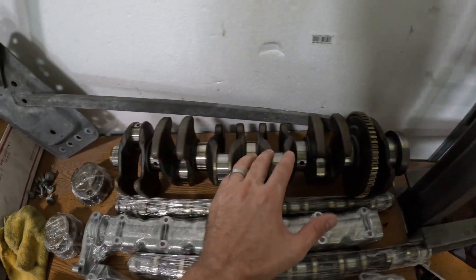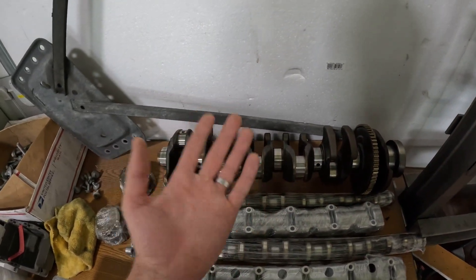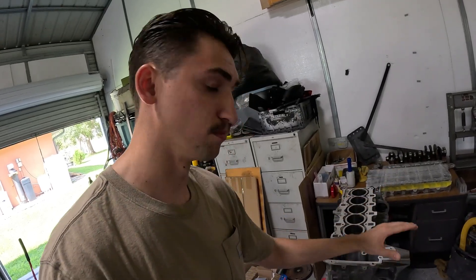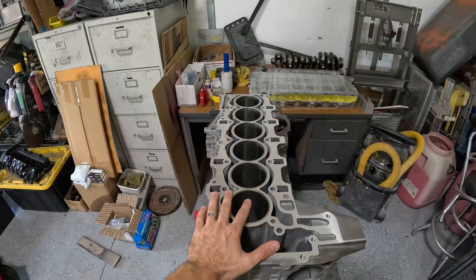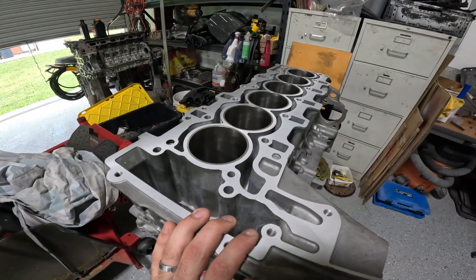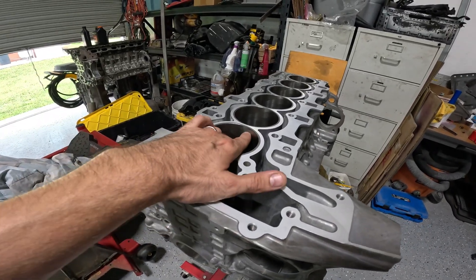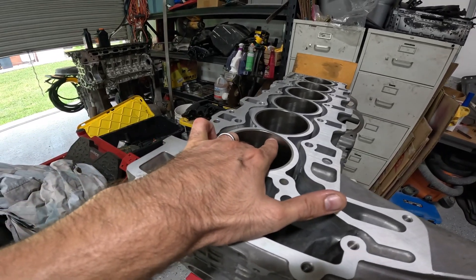The crank is in perfect condition so we can still use it. It is an 8 bolt but I will be using an upgraded flywheel for a DCT transmission. I already fully stripped out the motor and the head and took it to a machine shop — they checked everything and it's all in spec. I got both the block and head resurfaced, and I also got the cylinders honed. They told me the cylinders were nice and straight. I know a lot of builders recommend going to 84.5, but I just like to keep the stock bore.